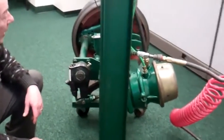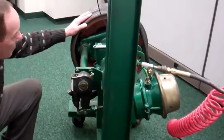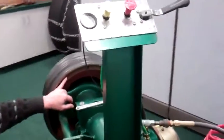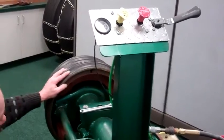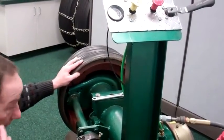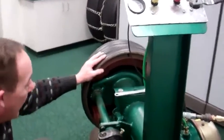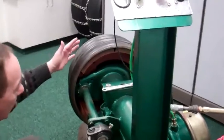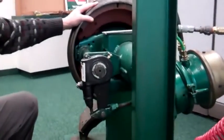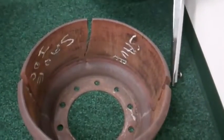At that point, I can quickly look and make sure that the brake drums and the brake liners have no cracks. If they do, I'm not going to hook up to the trailer because it's going to have to be fixed first — why hook up to the trailer? Things such as brake drums like that right there, where it's very obvious that there's a problem.